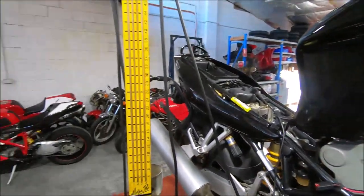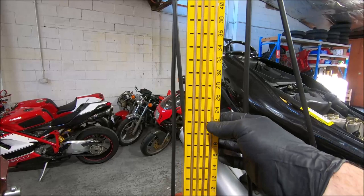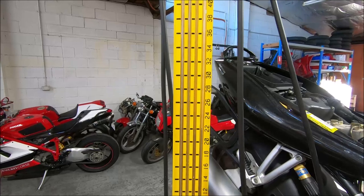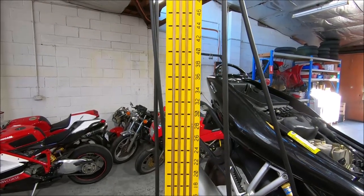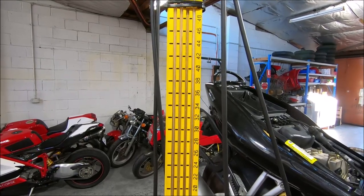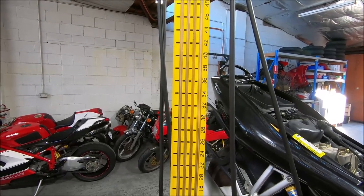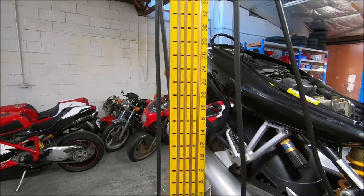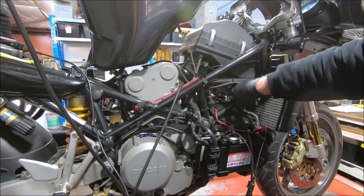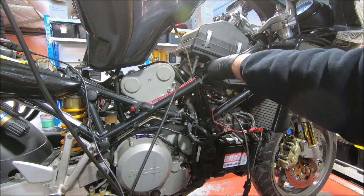And you can see on our gauges that it's much more even. We'll give it a rev up and see how it goes. I'd say probably a little bit too much opening on the vertical, but when you're adjusting that front lock nut and tightening it up, that often happens. So I might hold that link and wind that in a bit.